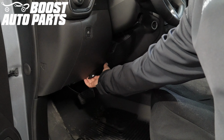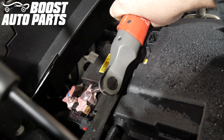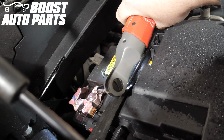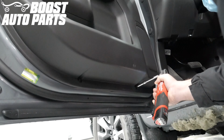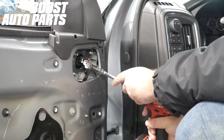Begin by popping the hood. Using a 10mm, disconnect the negative terminal on the battery. The door panel removal and installation, as well as the mirror installation, is detailed in a separate Boost Auto Parts video that will be linked in the description below.